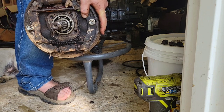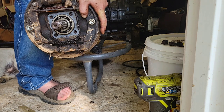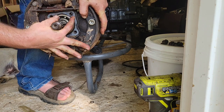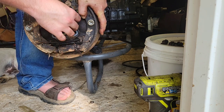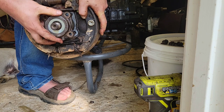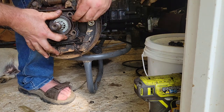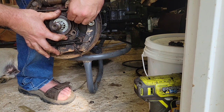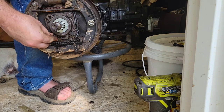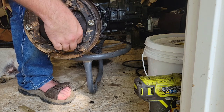The bearing goes in the housing, then your backing plate. They're going to have a paper seal or a gasket — on the more modern axle seal kits, a ring that fits around that bearing housing. The whole outer perimeter of that bearing retainer cap has a beveled end, and it slides up against the o-ring. I put the bearing cap on with the spacer and seal already in, and there's an o-ring that goes between the spacer and the beveled part.